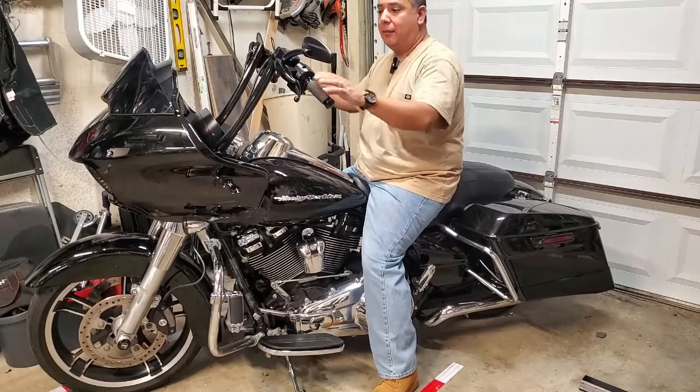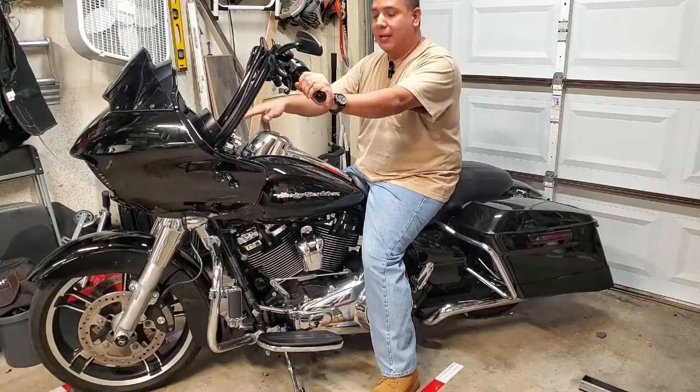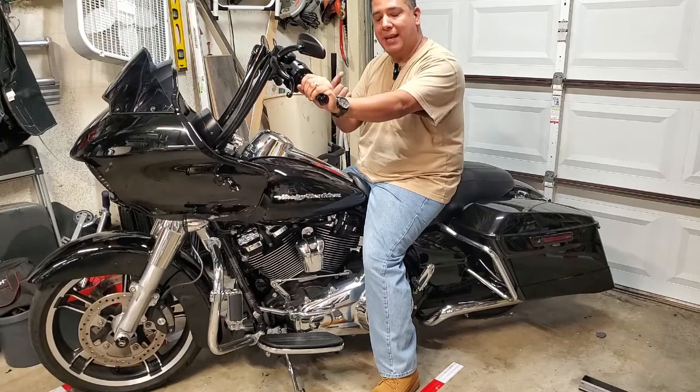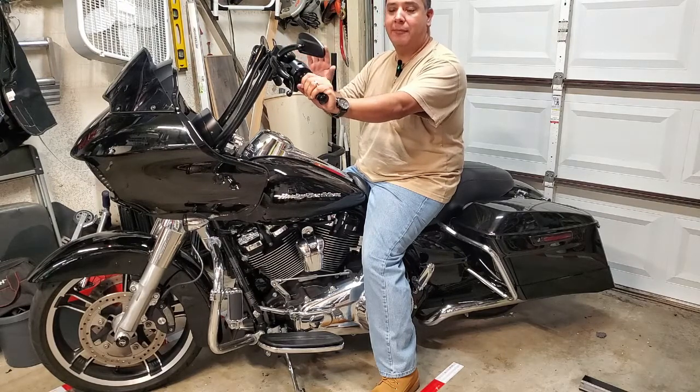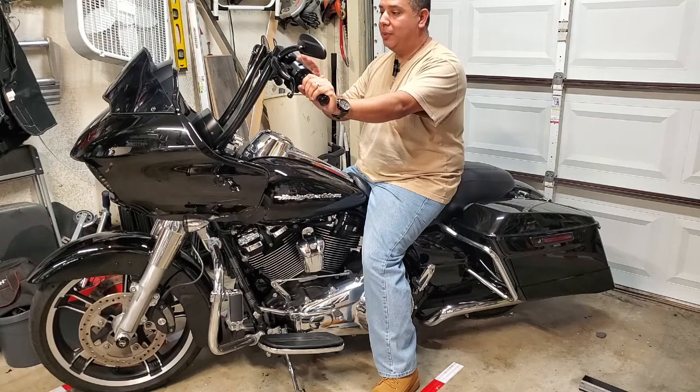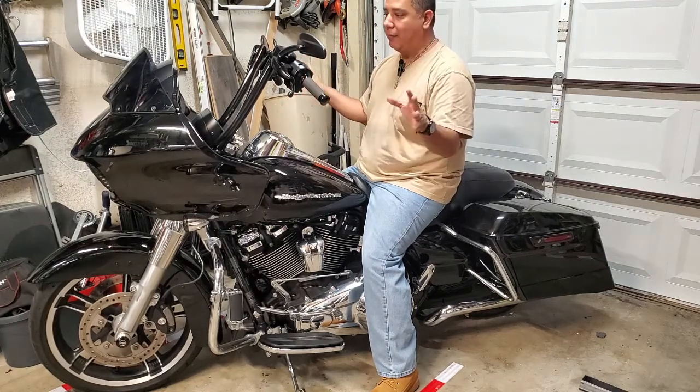now I've got my bars pulled back, and if you don't know, in the clamp area on the bottom side, there's a pin that pops out, and it'll only allow you to adjust your bars forward and backward minimally. Okay, so you can't do it. Now you can knock that pin out if you want, and you can bring these things all the way back however you want.